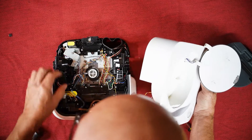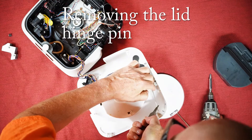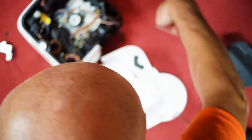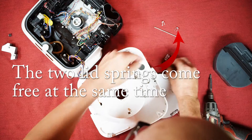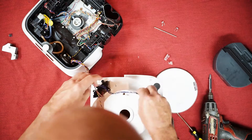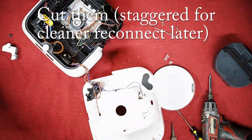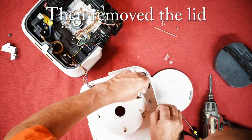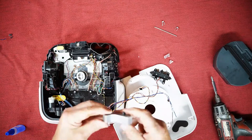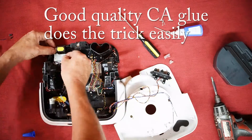I found a loose part — it looks like a weight in the back left. The stubs just broke off, so I'll set it aside and glue it back on later. Then using a pair of needle nose pliers, I removed the hinge pin and the little springs come out along with that — those springs have tension for the lid. There were also little pieces of plastic scattered around the base that were originally part of the hinge. I made sure the wires were color-coded for reassembly, then used little snips to cut them staggered to make the reassembly neater. Then I fixed the weight by loosening the screws, applying CA glue, and tightening them up again after the CA set.